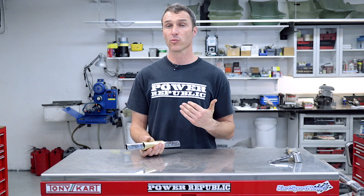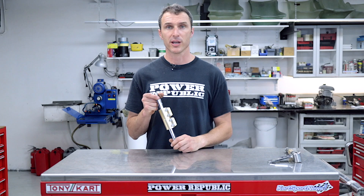On the subject of twisting the chassis — when you add the front bar it makes the front of the car very active. When you turn the steering wheel, everything is rigid in the front and you're going to get a lot of jack in the back of the car, which is critical in the wet to get the rear wheel off the ground to get you around those corners when you're understeering in slippery conditions. Obviously you can go too far and you'll get some monster jack that hurts your lap times, but generally speaking you want to add a lot more front end grip and steering in wet conditions. If you want to get more complex with your wet setup, you can start to add castor and camber — we do cover this in another video linked in the description. I like to add castor to my karts in the wet because it really helps to make the kart jack. You're adding more steering because the kart slips so much on the way into the corner, and it always seems to cost lap time. So I always put the most amount of steering in that I can in the wet.